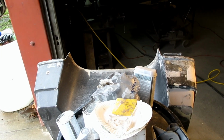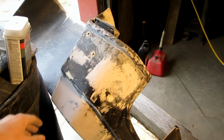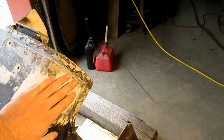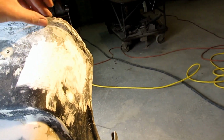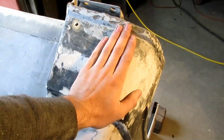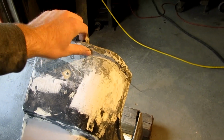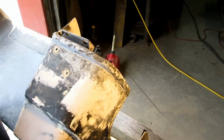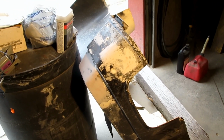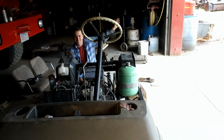they're looking very similar, which is good considering this whole corner was missing before. I still have several more layers to probably do here. I think this edge needs to be a little bit thicker. And then it'll be, again, the same thing, the finish bondo, skim coat. And I'll do a skim coat around the flare too, to smooth all this out. But it's coming along. It already looks better than it did. And Josh is over there putting things back together.